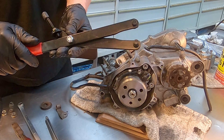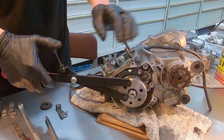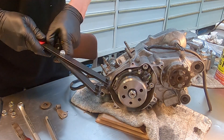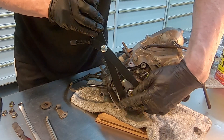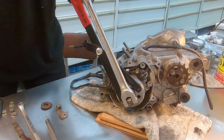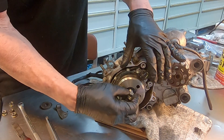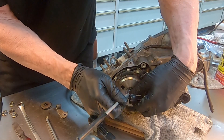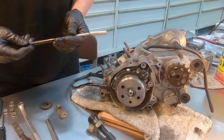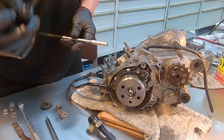If you don't have one of these, you're going to have to get one. This is an ignition holder that we use to stabilize the ignition when you're loosening that center nut. This one's not too bad. There's a little washer on there — this is a magnet on the end of a wand, and I used a little jeweler's size screwdriver to pry up under that washer.